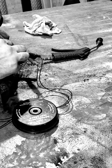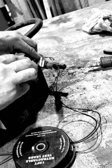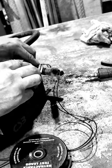You can see I'm intermittently connecting the fuel injector. Connecting it constantly can burn it out. It's supposed to be pulsed. There is a tool that will do that for you, but mine's not here right now. But here we go. Do a bunch of cleaner through it.